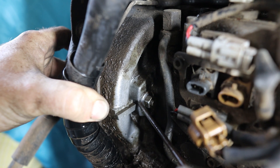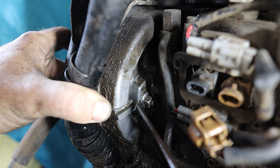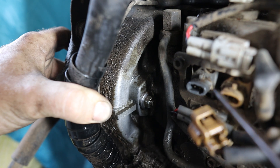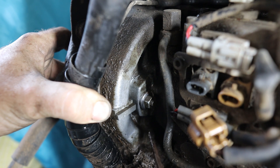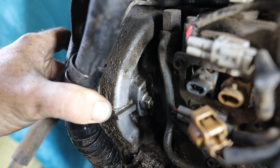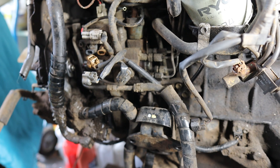It might be a bit hard to see that mark, but it lines up with the top of this lump of metal here. Basically, all you need to do is clock the pump. You loosen off the bolt here — the one that you can't see back in there — and the one on the back of the pump. Loosen them off, clock the injector pump, tighten it back up, and just make sure your mark lines up with the timing gear cover. The only reason it would be wrong is if you've taken your pump off, had it rebuilt, or rebuilt your engine. But from factory it should be right, and there's no need to touch it once it's set.